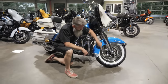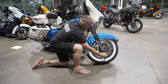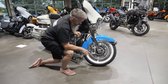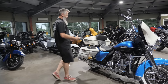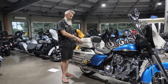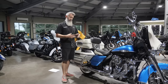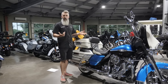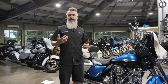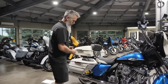The one thing to keep in mind when doing a Behringer caliper on the back of your motorcycle: the bleeder is positioned such that on the front it's on top, but when you put this caliper on the rear it ends up on the bottom — you can't bleed air out of the bottom. To bleed the Behringers in our shop, we take the Behringer off where it's mounted, put it on a spare rotor we keep on hand, and two guys bleed it — one holds it and one pumps or uses a vacuum — with the bleeder at the highest point. Once they're bled you don't have to worry about air in the lines. Then we reinstall them the way Krauss Moto designed the bracket.